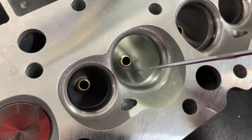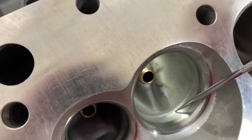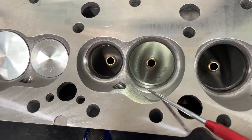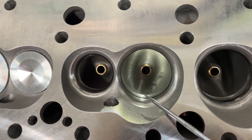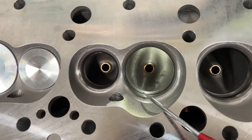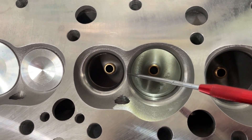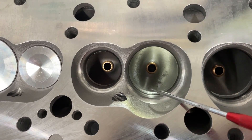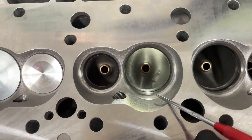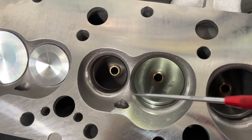It's a 2.165/1.600 valve combination. It's got a top cut that comes off pretty good — not a huge ledge, not bad. There is a ledge here which might hurt flow, but we'll find out. 45-degree valve job. I'll warn you: the one thing I don't like about these heads for sure is that the base material they use is hard. So when doing the valve job on these, it is one of the harder ones to cut. They look really shiny but they're really hard to get round. Usually there might be a low spot right through here and a high spot over here because the cutter deflects — this material is so hard it's really tricky to cut, at least on my machine. Bigger machines, maybe not so much.